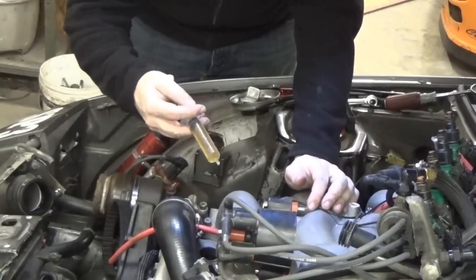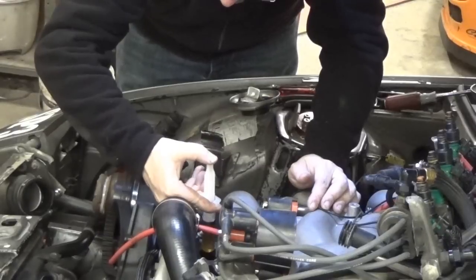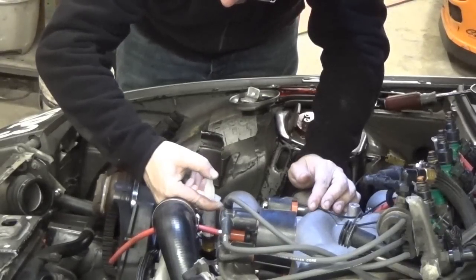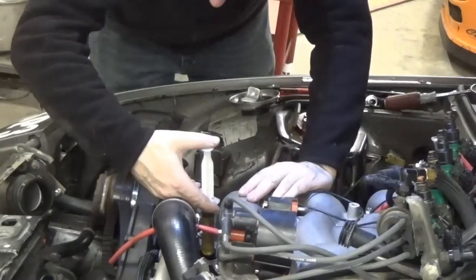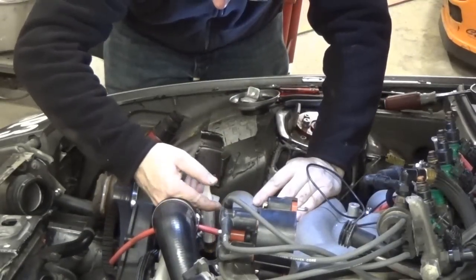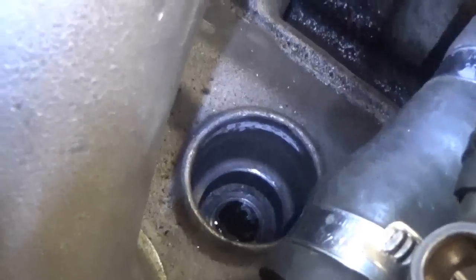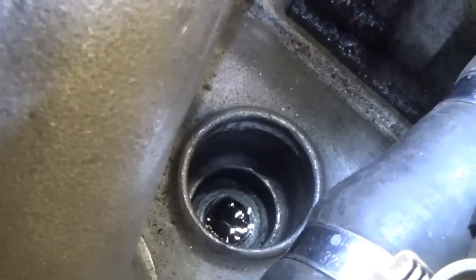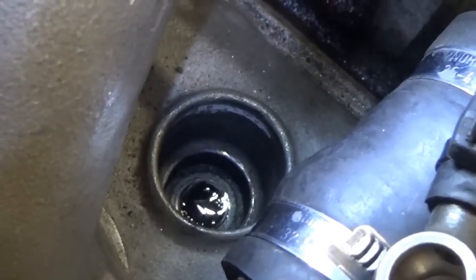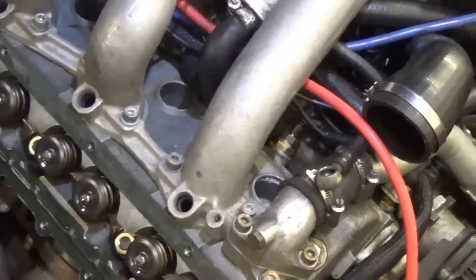First dose — 20 milliliters of oil in the syringe, right down the hole. It was hard to see where the bottom of the spark plug threads were, so I filled it up to the top of the spark plug threads. I'll measure the diameter and length of the spark plug and subtract that volume from my calculation. This took five syringe-fulls plus 19 milliliters, so that's 119 milliliters total.